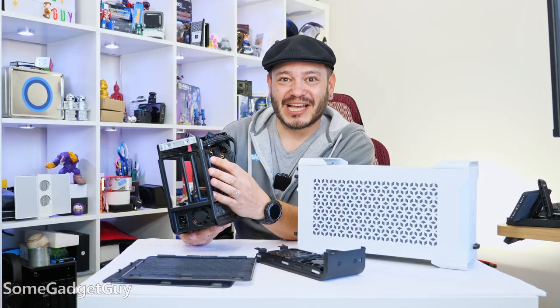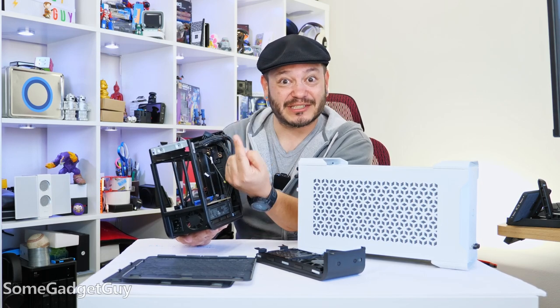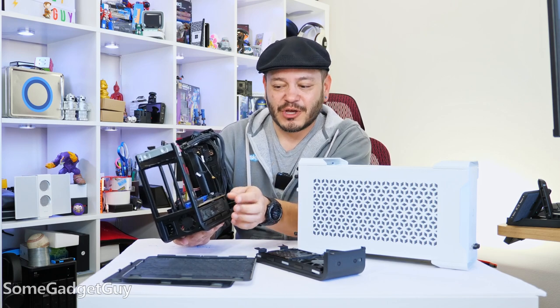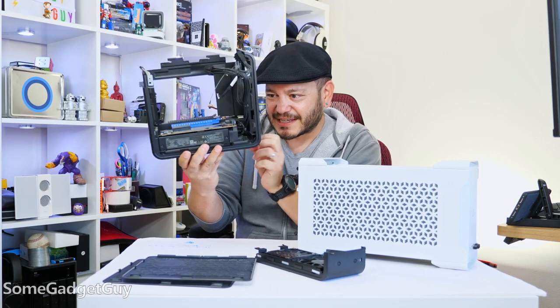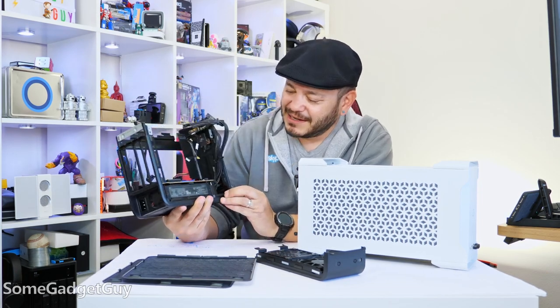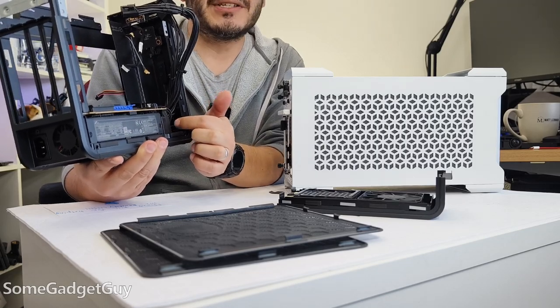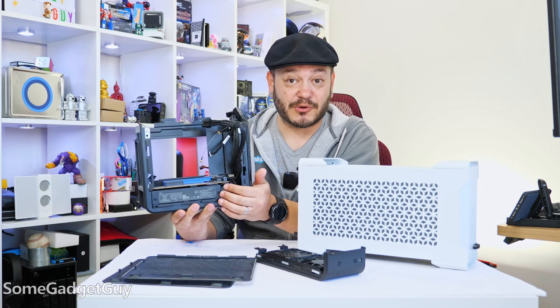You've got two cards sitting on top of the power supply with airflow just kind of hovering in that space, coming up out the top of the case, but nothing really helping air get in and through where the power supply is just soaking. There are some vents and a little bit of copper, but that's not a lot — especially when all the cables are pushed down into the front of the case, really blocking where air would go to cool the power supply.